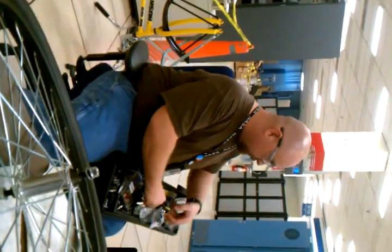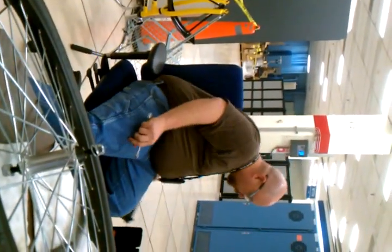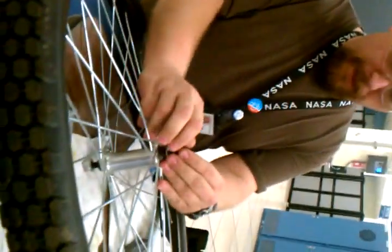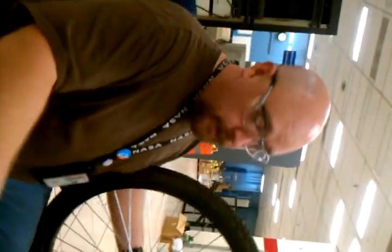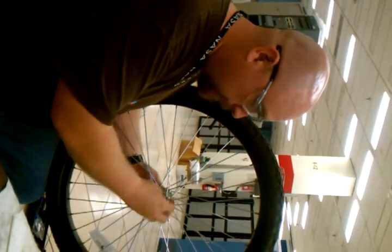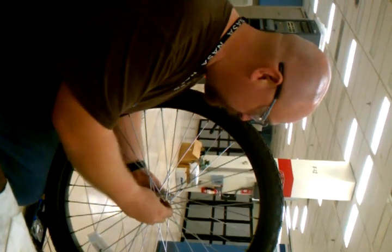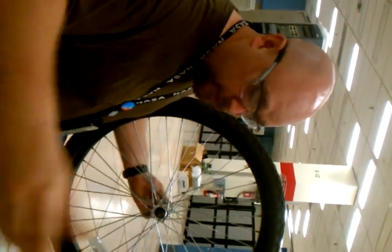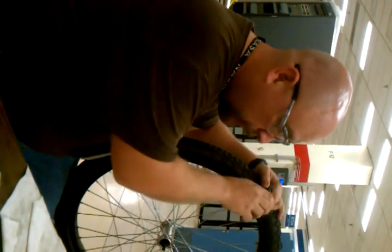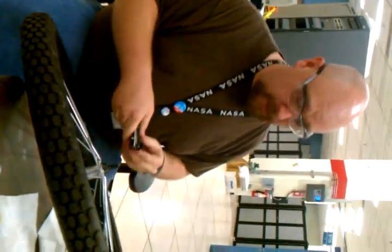These days, loose ball doesn't necessarily mean bad, even though they're not used as much as they used to be. The nice thing about loose ball and why they're still found in industrial bicycles such as these is you can maintain them yourself. Unlike sealed bearings, which you just throw away, in industrial environments where there's likely to be quite a few different types of bearings laying around, you'll usually have spares and workers themselves can take care of them.